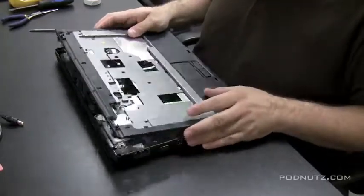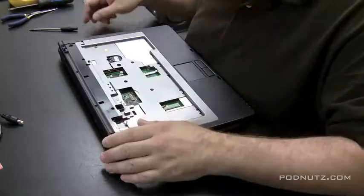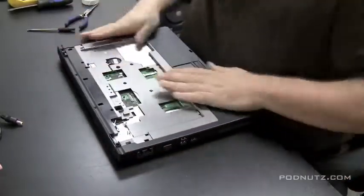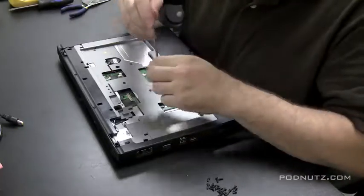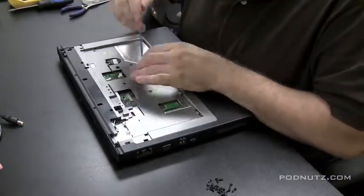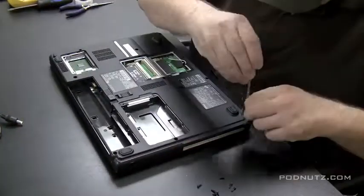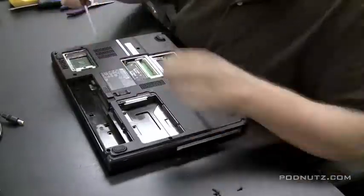Make sure this lines up exactly and it should snap right in. I'm pulling that wireless card wire through, making sure it's in the right spot, and the whole case snaps back on. There's my pile of screws — time to put them all back. I'm going to speed up the recording here since you saw how I took it apart; you use the same screws to put it back together. Very important: attach all the ribbon cables you disconnected earlier, like the ribbon cable going to the touchpad.